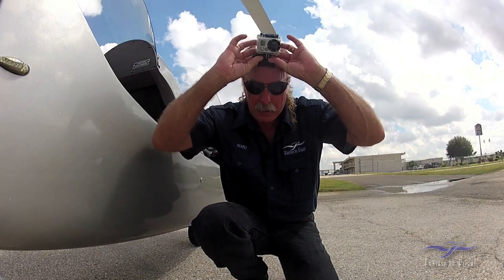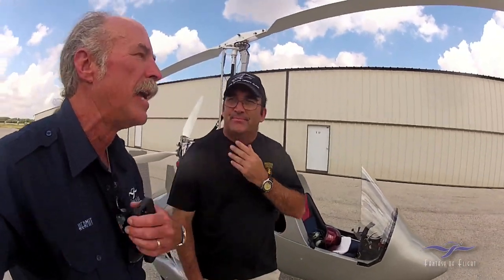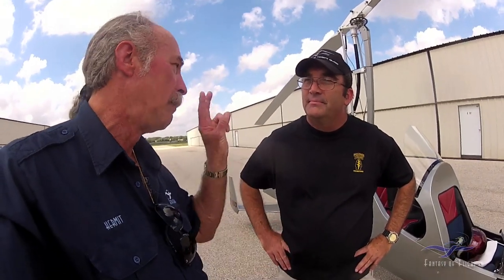What do you think, Kermit? That was pretty cool. When it's light like this, you could just about honk it and do a hover landing like the Pitcairn — I can see how they used to do that. What I noticed was it definitely has a lot more performance, a lot lighter. It took about 300 RPM less to maintain 60 at pattern altitude than with another person on board. I see what you mean with the power — if you hadn't been at it for a while. But as long as you're low to the ground, you could just about stop the thing if you three-point it. I can see with some rotor inertia in the older autogyros, how the guys could honk it and just settle down to the ground.